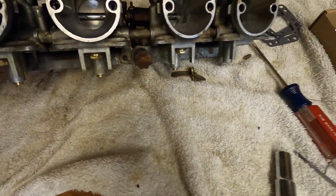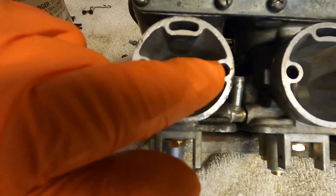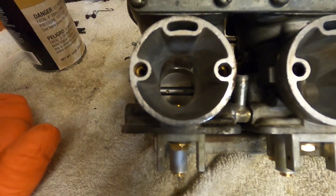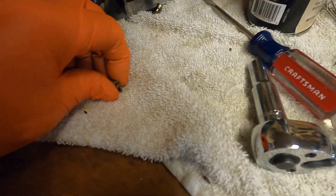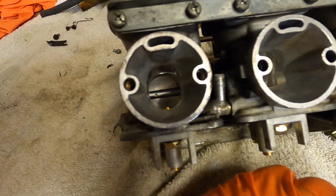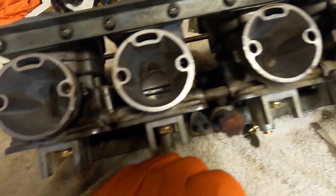The gasket area is clean as best as I could - it's going to sit flush, which is nice. Had a bunch of extra parts; some things have to be drilled out. I did notice that I have some extra jets down in there, so let's take them out and see what happens. I really don't think they do anything because they're just completely wide open, but I did clean in there so might as well give them a clean, take them out and put them back in.